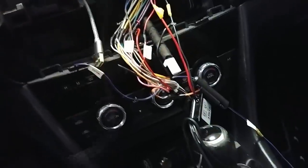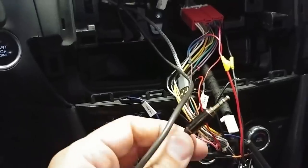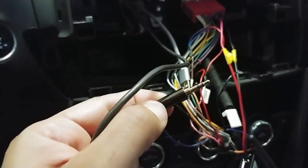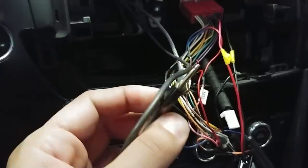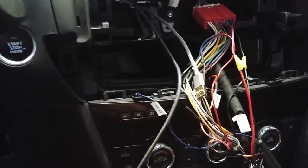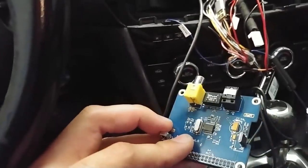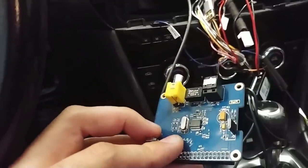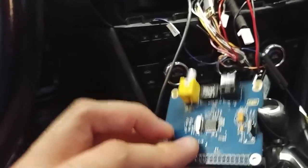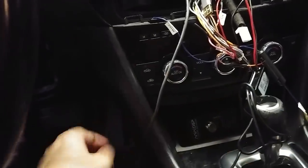So that's audio in. This is audio out - this is the audio going to my amplifier. This is temporary. Right now I'm using analog out, but I don't want to use analog - I want to use digital out using the HiFi Berry HAT, because my DSP supports digital input. But for now I'm going to start with analog because in case I have to troubleshoot anything, I don't want to deal with the extra complexity. Standard analog output should be easy to work with to start.